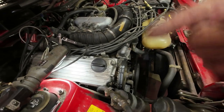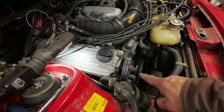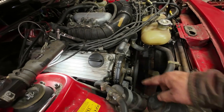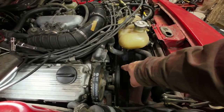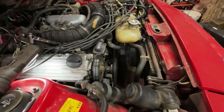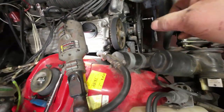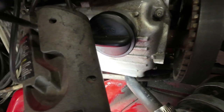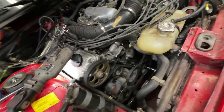Now I'll turn 180 degrees on the crank, bring the piston up again until it hits, it'll be on the other side of that. Because it's only one turn for two, that gets one turn for one. So bring it around one turn on that, and then I'll figure it out. Okay. Yeah, so now I've got a mark there and a mark on the other side of it. So I'll back that off and pull that thing off the piston. Looks like it's about equidistant there.